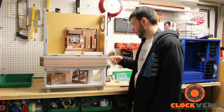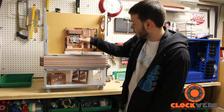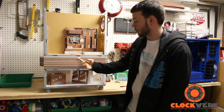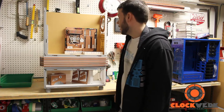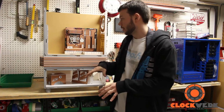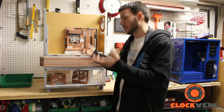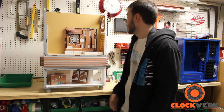And then I also have to make this extension panel. It'll be a bunch of jumpers from all the hidden ports on the motherboard and graphics card. It'll go to this panel here, so I don't have to reach in the case to plug things in. So yeah, then it'll be final paint. I'll tear the whole case down and paint everything and build it up from the bottom up once I have all the electrical sorted and all the water cooling sorted, so I can just build it and get it all finished as I go. So yeah, that'll wrap up this video.